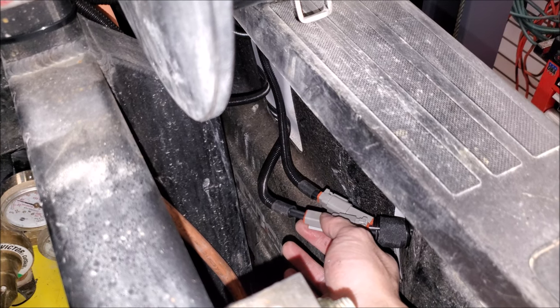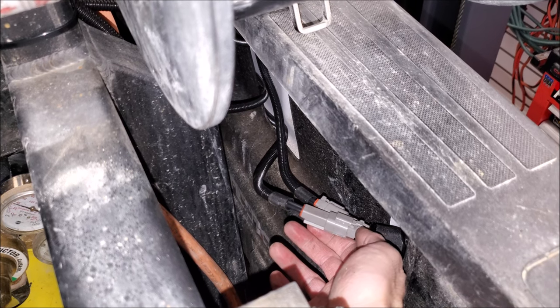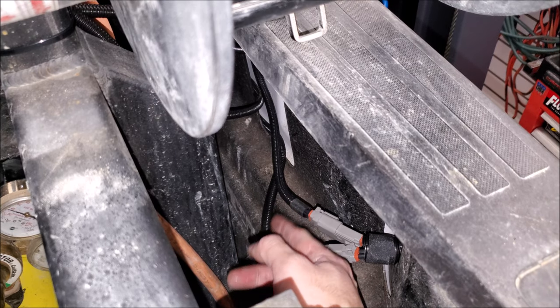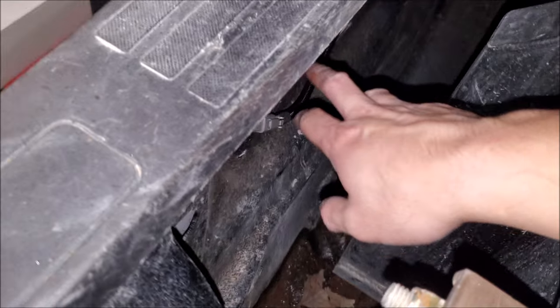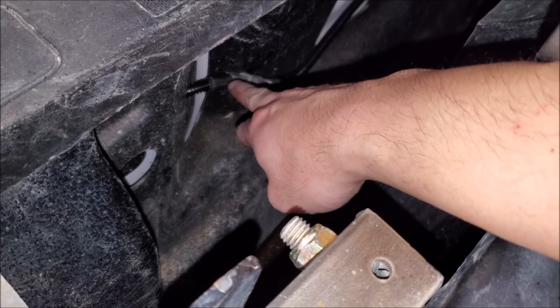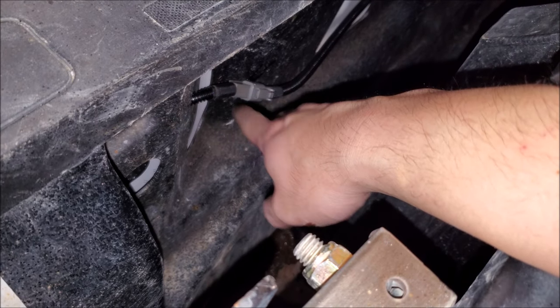To make sure that auxiliary one and three don't get mixed up, I've actually inverted the plug — I have the male on one end and reversed the plug orientation so you can never plug these in backwards. Over here we have it on the other side. The nice thing about these Ford trucks is there's a plastic knockout here — just knock it out, drill a hole, and drop the wires down. Very easy. They do this for RVs and other accessories if you need to run wiring.